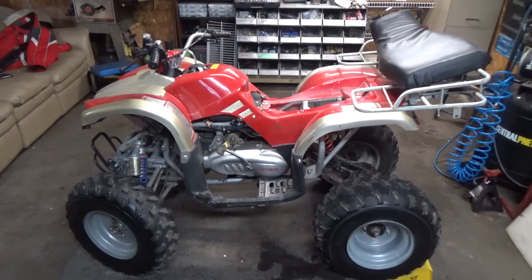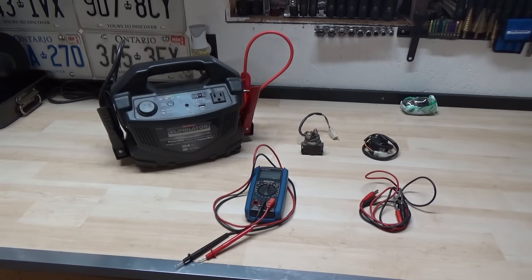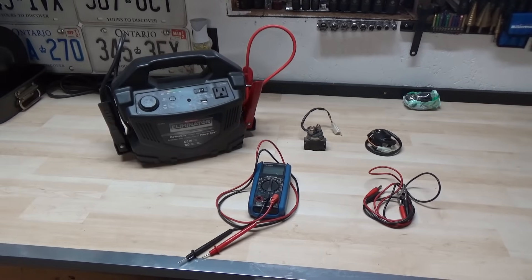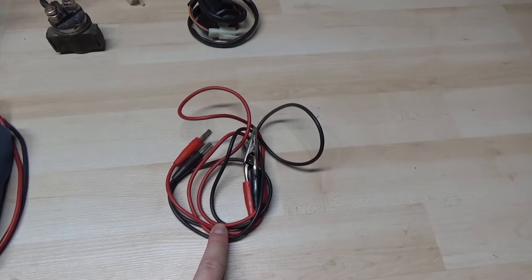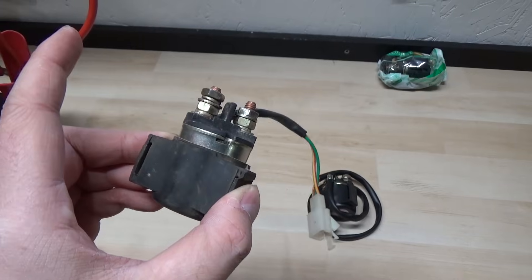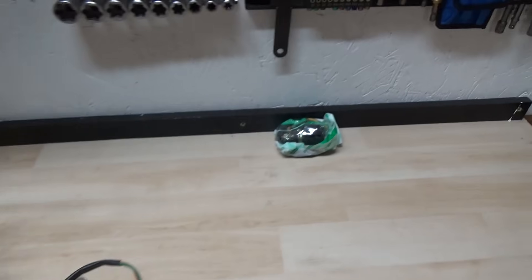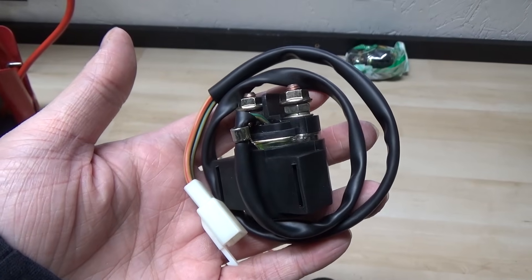In this video I'm going to take you guys through the steps I went through to diagnose this. To do all the stuff I'm showing you, you're going to need a few things: a source of 12 volt power — you can use a battery, we're using an eliminator because his battery was dead — a multimeter, and an extra set of leads with alligator clips because they're a lot easier to work with. We have here our seized solenoid — and I have our new one ordered from Amazon. I even ordered a spare because these are known to burn out, and for the price I got a spare just to have it.